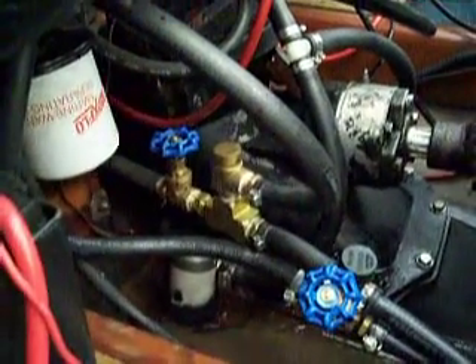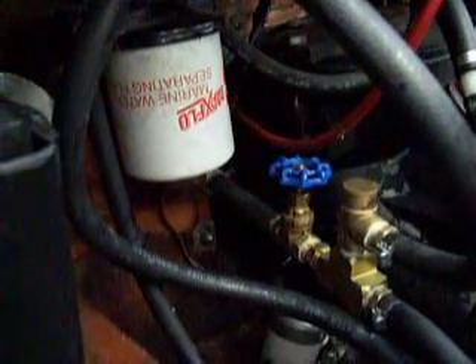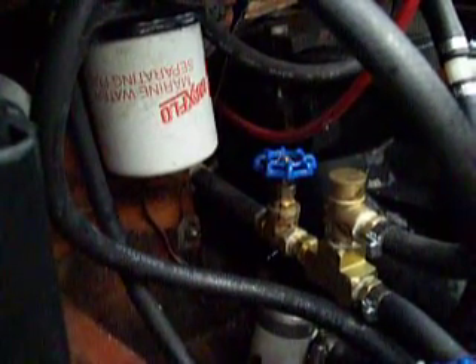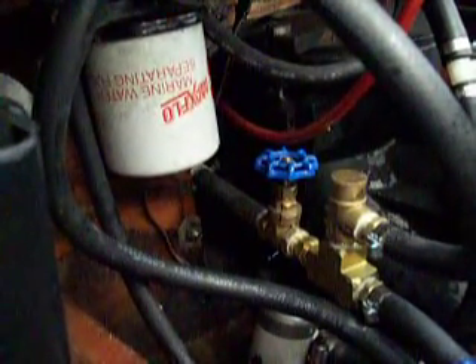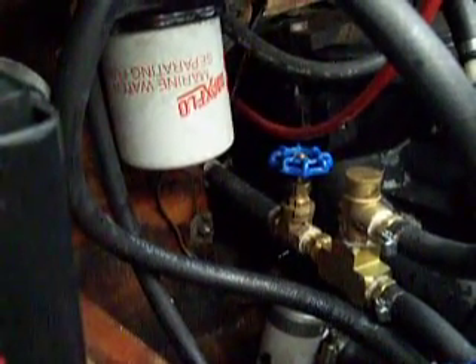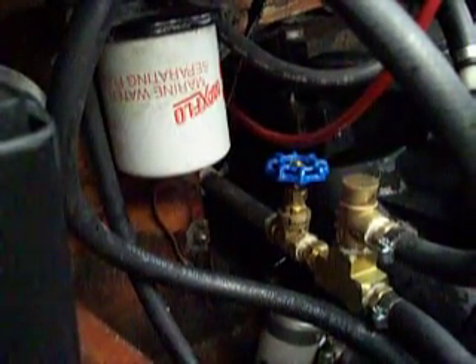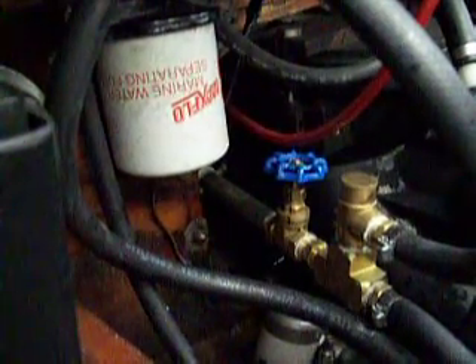That's our system — it's real simple. It just connects directly into the jet drive in the back. I'm using a half inch pipe tube from the jet to the gate valve. Some jets will just come with a barbed fitting directly from the jet and a hose connected to it, so you may have to unscrew that fitting from the back of your jet and get yourself a pipe tubing. The other option is to just run a piece of hose from the jet directly to the gate valve, replacing the connector at the back of the gate valve with a regular barbed fitting.